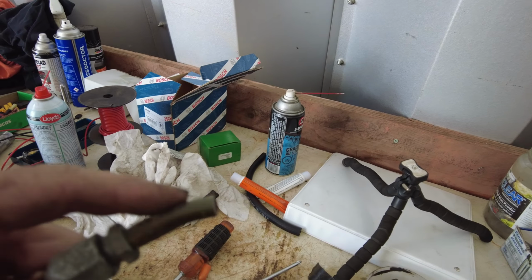Yeah, so I decided to take off the wheel here. Makes life easier. Anyway, there's the fuel accumulator in there, and this hose here comes down to the fuel pump here, which isn't in there yet. So the next thing is getting the fuel pump into place. This thing here, see that? That's where there's a clamp that goes on there to hold everything together afterwards, right? And it also holds the gas tank in place. So you want to be careful moving that around.